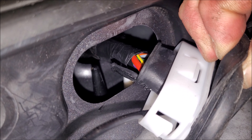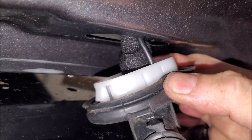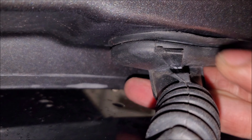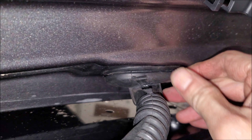Before you put the seals in, take your time and work the boot over the plastic. You can see here it's flanged and there's a seal that it has to go into. The hardest part is working behind where you can't see — take your time, work it on. Use glass cleaner as a lubricant to help work it over, then go ahead and click it in.